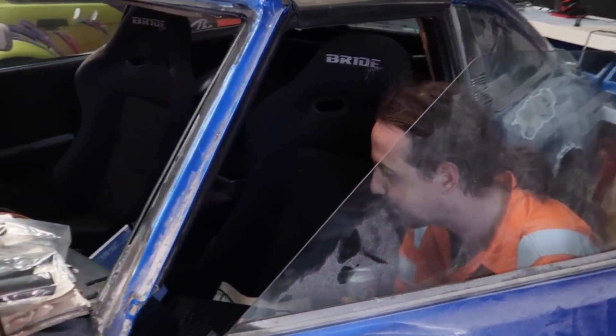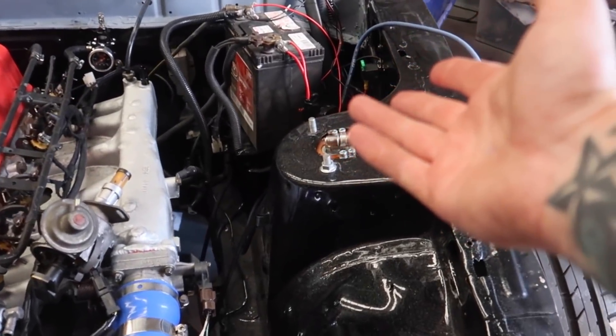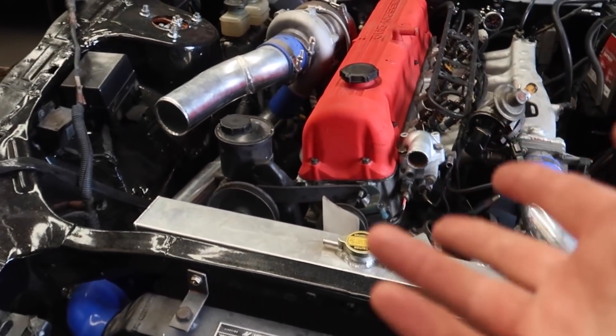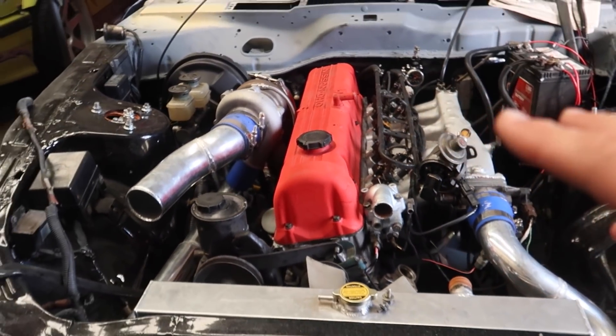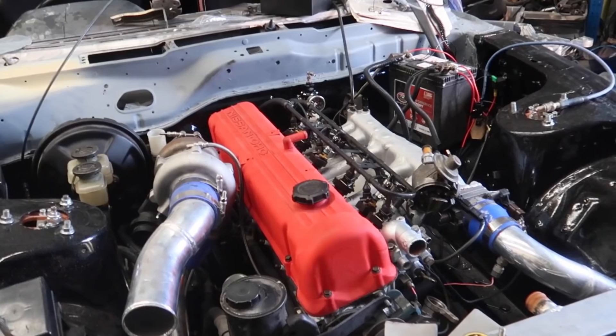It's my first ever brand new ECU that I've ever bought so I kind of was gutted that we made that mistake, but it is what it is. So now Kwana is just going over the map, making sure that it's all good and that we haven't got any settings in the ECU mucked up before we go ahead and put the power on. Then we'll plug our LS coil in with our spark plug, spin the dizzy, confirm that we have spark, do the rotor phasing, make sure it's all timed up perfectly, and then I think we can turn the key.